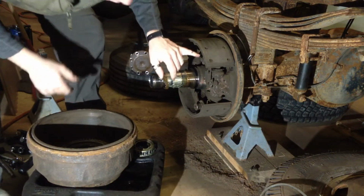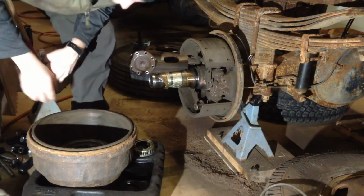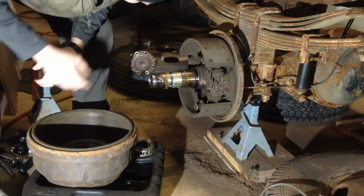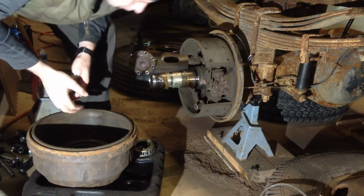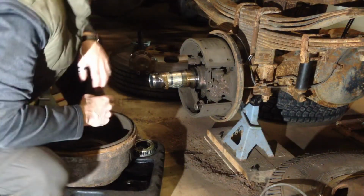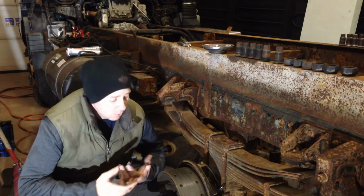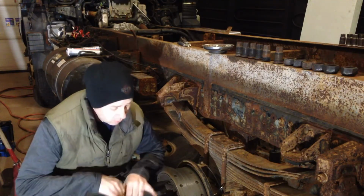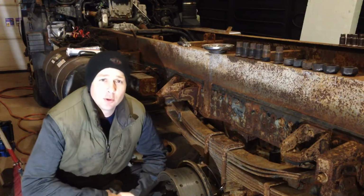And now we can get a good look at the amount of shoe material left and the inside of the drum. Give a good inspection in there. Check out our bearings and the running surface here. Check the level of grease. Do any of the service needed. There you have it, fairly straightforward process. We've got it all torn apart, ready for an inspection. Any parts that need to be replaced or adjusted, new bearings, new seals, anything like that, re-grease it. Next video, we'll throw it all back together.